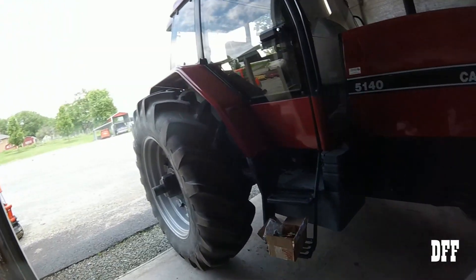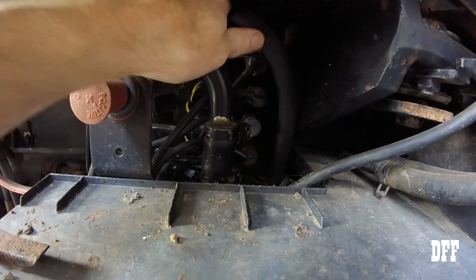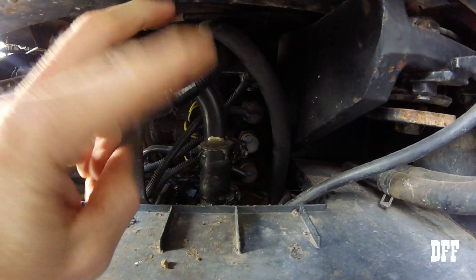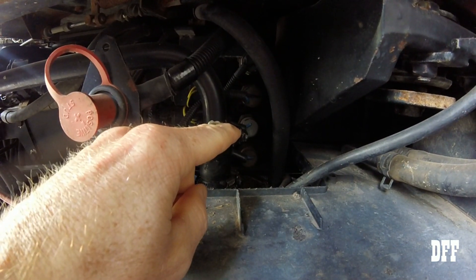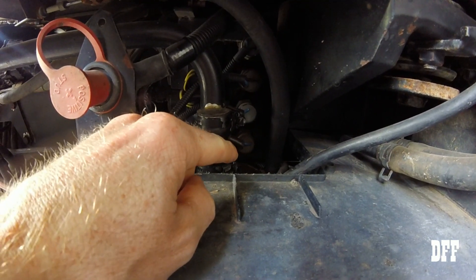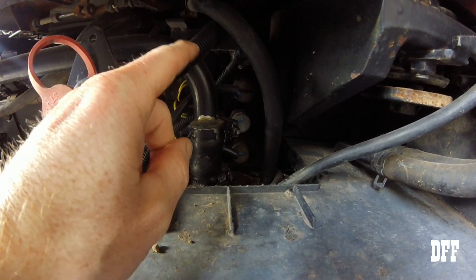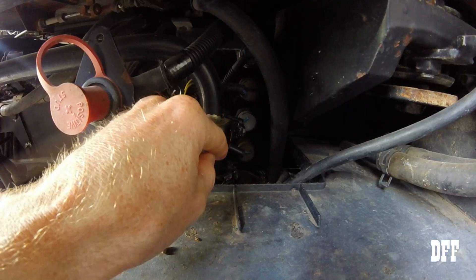Over the course of time we've tried to narrow it down. There's four power shift switches, one for each of the four power shifts. Those power shift switches are right here. There's one up there, two, three, and four right here all in a row. Two of them look like they've been replaced — the top one and the second one up from the bottom. The very bottom one has some moisture on it and it's retaining dust and dirt, so possibly leaking. The third one up is just completely different than the other two. I'm going to guess that is power shift one, two, three, and four — I think they start from the bottom up. So I'm going to guess two and four possibly have been replaced.